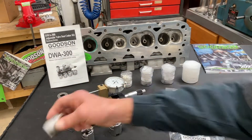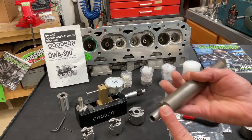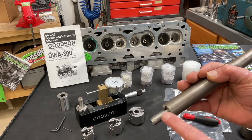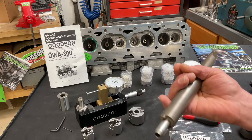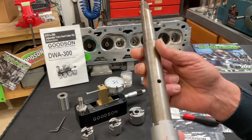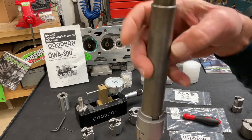Now these things are driven in a variety of different ways. On the particular machine I'm going to use is our PH-2000 — it has a number three Morse taper drive. This has a wear sleeve that has a 375 pilot ID, and this is 9/16ths or 562; inside of this hole is a 562 hole. These dog ears, as I call them, fit into that slot and actually do the driving or rotation from the quill of the machine, locating on your pilot in the valve guide bore to precisely hold this as we machine that.